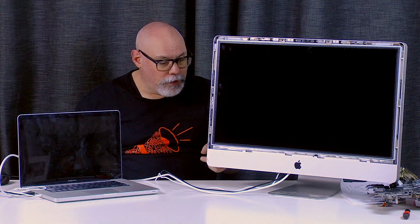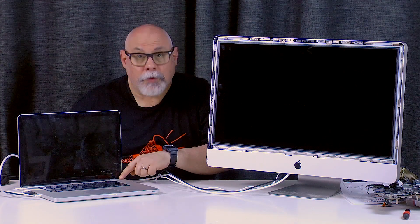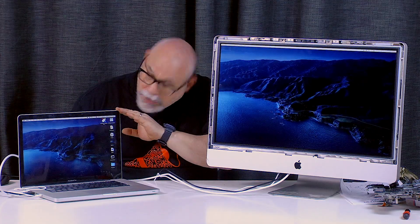Okay now it's time to test. I need to turn on the display first using the old power button from the iMac. I could hear it make a slight little pop as I switched it on, otherwise pretty silent. There it is — a beautiful big display here attached to my MacBook Pro. I do have some brightness controls underneath here: you put your fingers through the RAM slots and you'll find two little push buttons. Press one to bring brightness down and the other to bring it up. A little bit tight for big fingers like mine but still workable. I'm pretty happy with that.